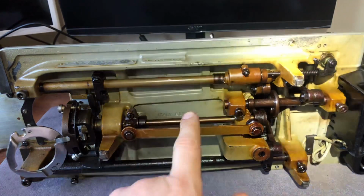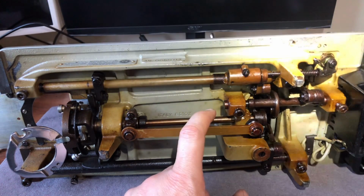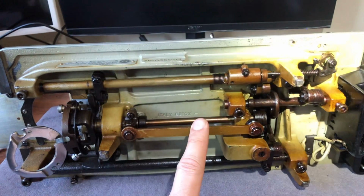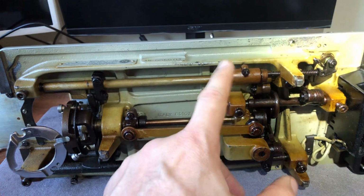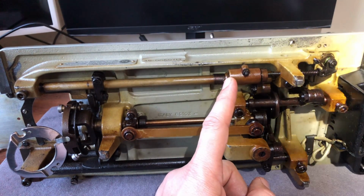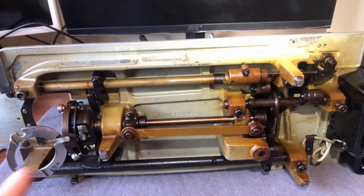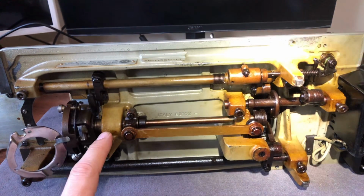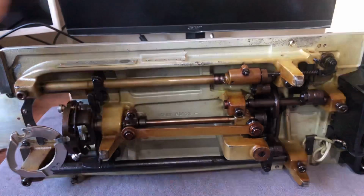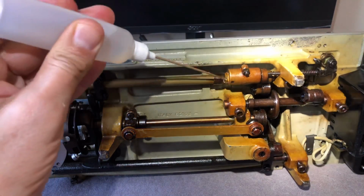Why? This is painted. If you have old oil, you want to make sure that you have used penetrants, alcohol, or something where the parts are moving against each other, again, to allow for as little friction and as much power as possible. But if you have oil on the outside of this, it's not hurting anything. It has no impact on the performance of your machine, and it also is a rust inhibitor, right? I'm not saying you should ever go and just go to town and take a machine that's not rusted and start oiling all over the place. All I'm saying is this, in some ways, I have seen machines at times where the old oil and grease protected parts, and other parts that didn't have it got rusted if the machine was exposed to moisture, right?